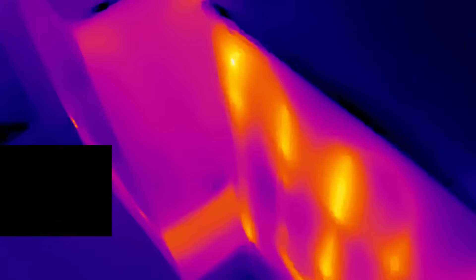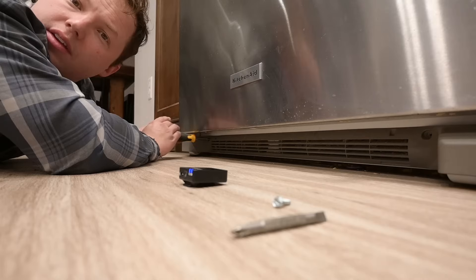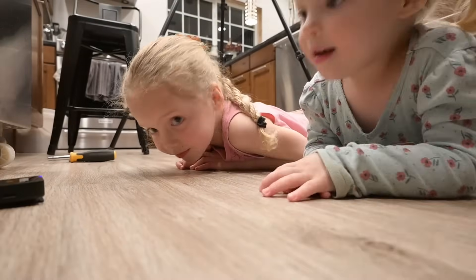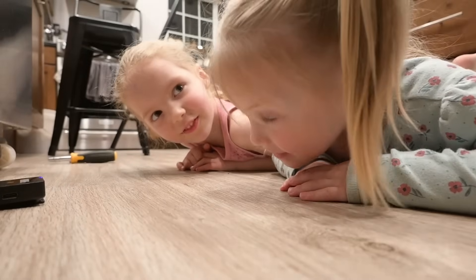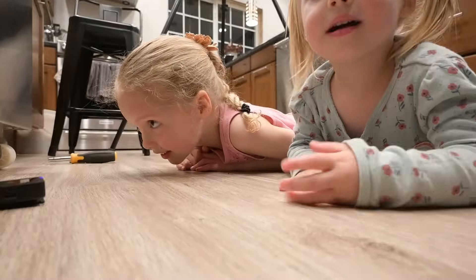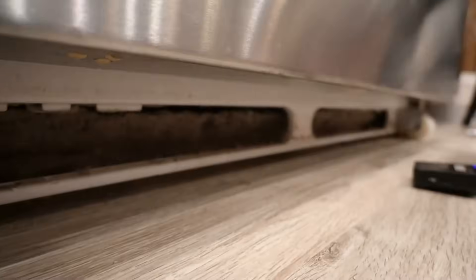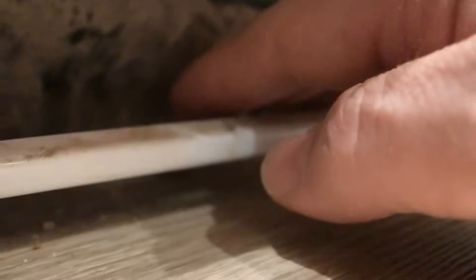That's why we're going to go back inside and clean the condenser on my refrigerator. Looking down under the fridge with the kids — you can see that there is essentially a coil under here, and look at how much stuff is in there. We can see corn, beans — that's from the sensory bin. If I pull this panel off, you can see the condenser coil and all the debris that's built up.